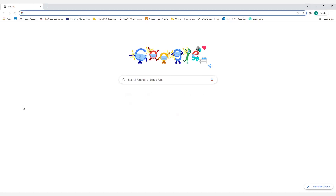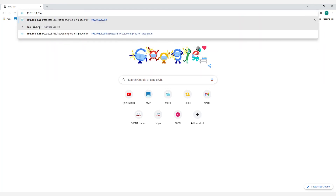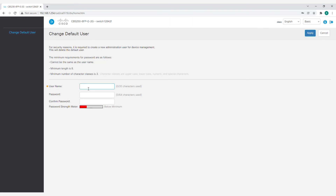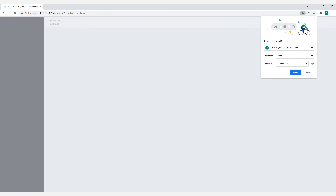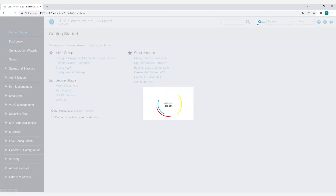Select and open a web browser. Enter the IP address of the switch in the address bar. The default IP address of the switch is 192.168.1.254. Once connected, the switch will prompt for a username and password. The default username and password are Cisco, all lowercase. Configure a new password for better protection of your network. Enter Cisco in the old password field and enter your new password in the new password and confirm password fields. Click Apply to apply the configuration. Once prompted by the pop-up message, click OK. Click the blinking save icon to save these settings to the startup configuration file.